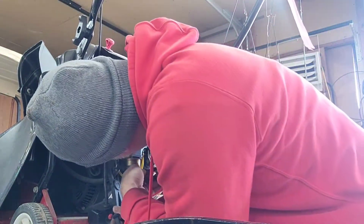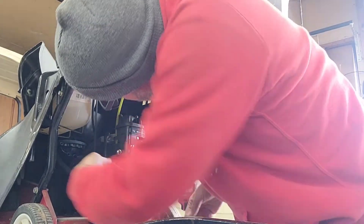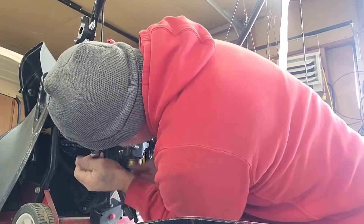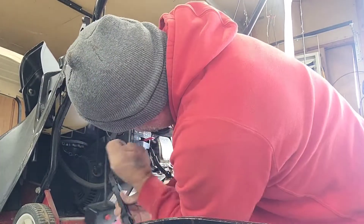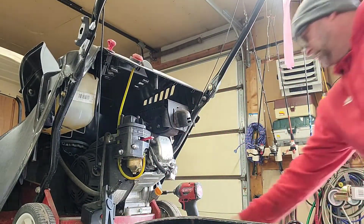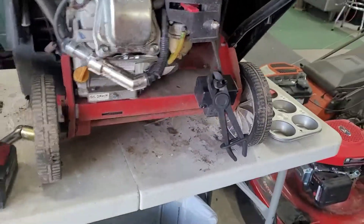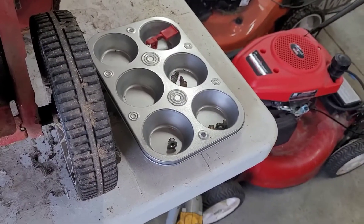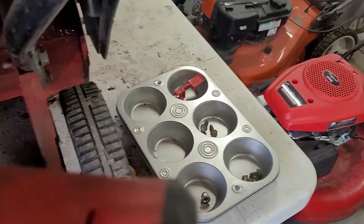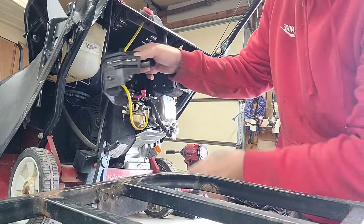Got those off — put them in the old muffin tray. Get those from the dollar store. All right, whole assembly is out. There's the little primer tube. Now when you're doing this it's very easy to wreck these plastic pieces, so be careful. Do that spring first and be very gentle — if you stretch that spring, these things are very temperamental.